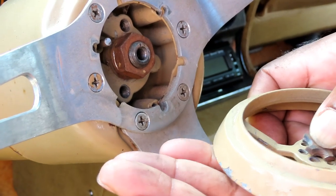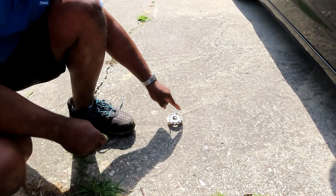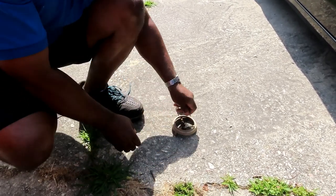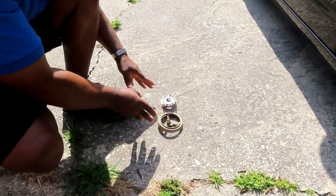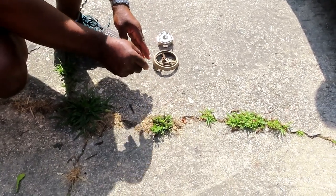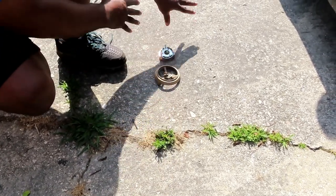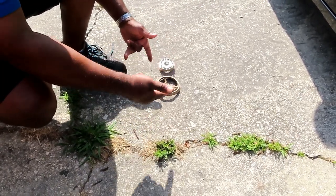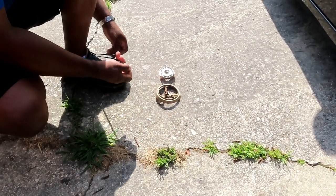What the heck is a party line? Matter of fact, let me show you. We'll be right back. All right, guys, this is the first part we took off. Now, here's the next part we took off. The reason you're doing this is that if you're not used to a job, every time you take off a part, you put it down in a line. When you go to put the job back together, you start from this end of the line and work your way back. This way you don't have a bunch of parts over in the corner getting confused, and put the whole job together, then forget one part. That's what I call the party line. Yeah, buddy. All right, guys, let's get back to our job.